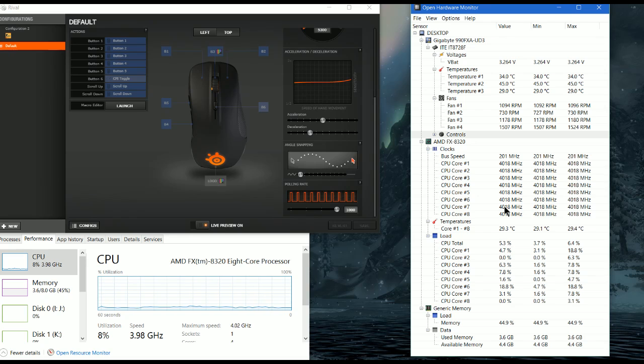So having the ability to customize it still allows you to use the quality mouse, but if you determine that the rest of your computer hardware isn't up to par, you may be able to decrease the polling rate in order to save some of that CPU time for the game itself. So right now we're at about 6.8% is where it peaked up at.